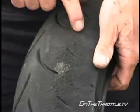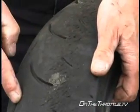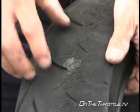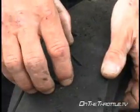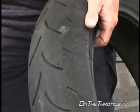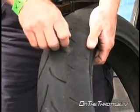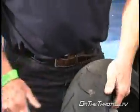Just by looking at it, remember the finger shape mark? Yeah. But then the 45 coming into the middle of the tire. So the pressure differential where this was set for the morning was wrong, and then the way the ambient temperature changed throughout the day, especially with the track temperature, it got to be too soft. That's why Michelins are sensitive to half a pound. You've got to track it constantly. And if you do, they're a great tire, works great, but you've got to keep really on top of data.